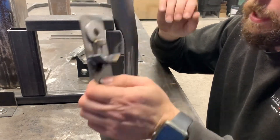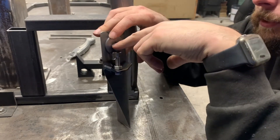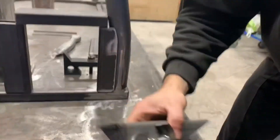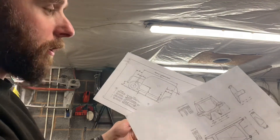If you look at some beam axles, these things are only this big. Now I didn't explain why these are so tall and why this hole is where it is. I made this chassis to run a certain ground clearance. What I did was I got schematics - readily available online - with heights, chassis lengths, all the dimensions you need. I thought I want to put two and a half to three and a half inches underneath my chassis, whichever you desire.